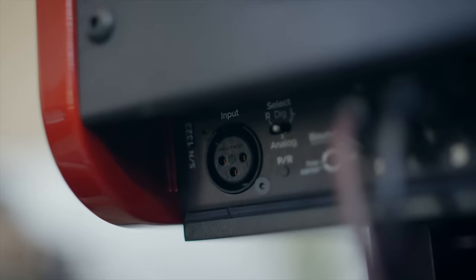The XLR on the back of each speaker accepts analog or digital input. For analog, the other end of your XLR cable goes into a DAC with a volume control or a preamp — that's how you bring vinyl in. A key question is whether the system can resolve differences between different analog inputs even after digitization on entry. The answer is a categorical yes: different DACs sound different into these. With a preamp it sounds fatter and fuller than a DAC going direct with its own volume control.